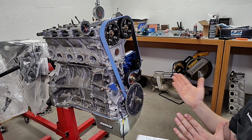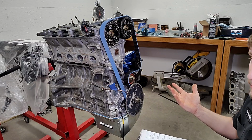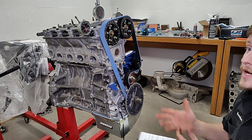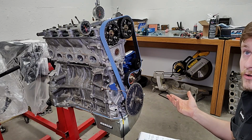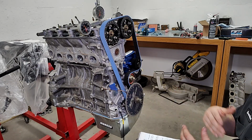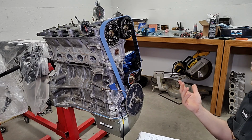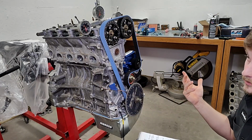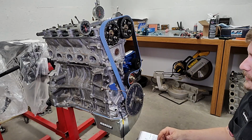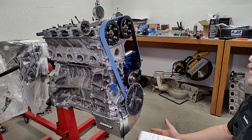Okay. When you're in such a small horsepower range, I mean, 400 is still a lot to a lot of people. It is a lot of people. Which is fair. But you can put a turbo on a stock motor and make 400 and not do anything to see that. You're just letting the turbo do all the work. And you put a smaller turbo on, all that kind of stuff. Our turbos are so ginormous that we're not even seeing boost pressure until like 4,000 RPM, which in a daily driver car, you're almost ready to shift. So the efficiency really matters for the power goal we're trying to see.